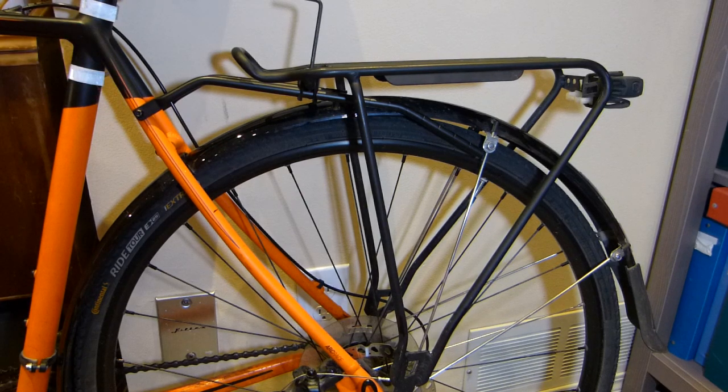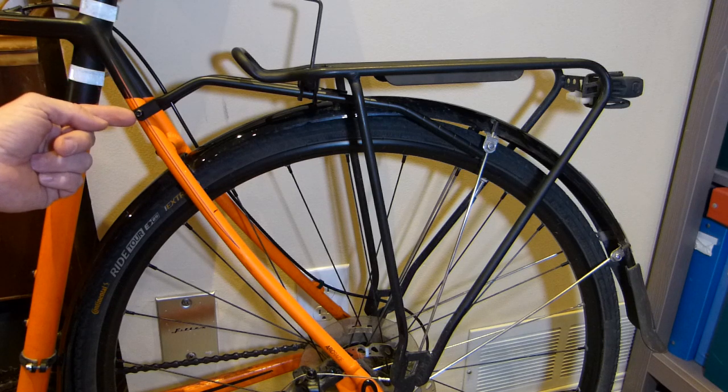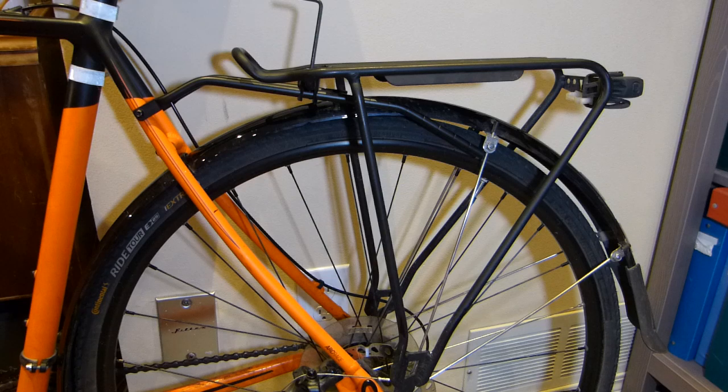I don't want to lose it, and I don't want to strip the screws and damage the aluminum frame because I'm not really ready to helicoil it and repair the frame. So 5 Newton meters is it. There is a small spring washer underneath this bolt here that secures it, but you can also go with blue Loctite or a suitable thread lock compound. So that's some equipment that you need.